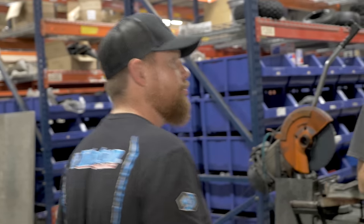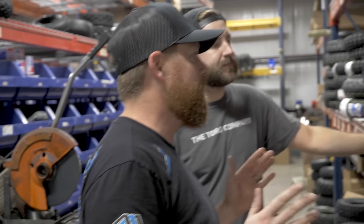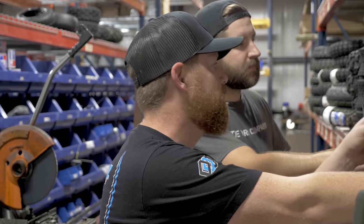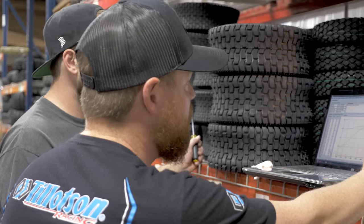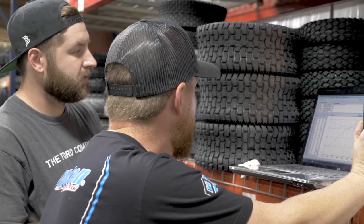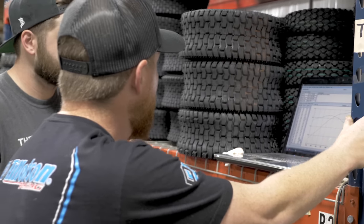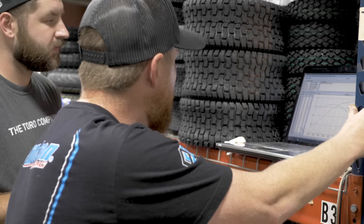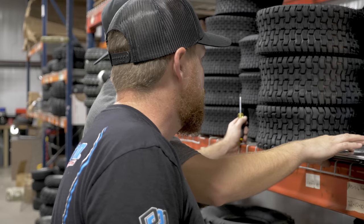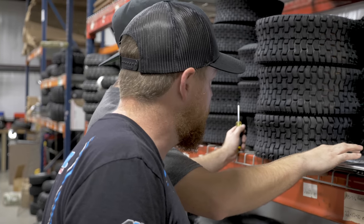We learned that the Hot 265 has a very wide power band. It makes really good power, 14 plus horsepower for more than 2,000 RPM, about 3,000 RPM. The peak horsepower was 15.86. Peak torque was 14.5 at about 5,000.